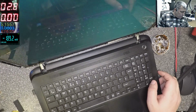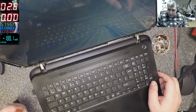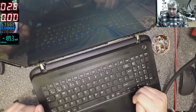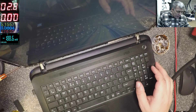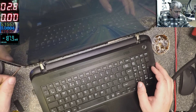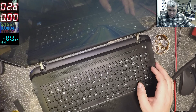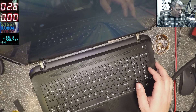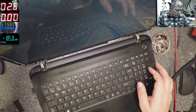For the backlight we have three signals: we have the 19 volts for the inverter, and we have two 3.3 volt signals — one to turn the inverter on and one for the brightness. One of these three is doing some dodgy things.